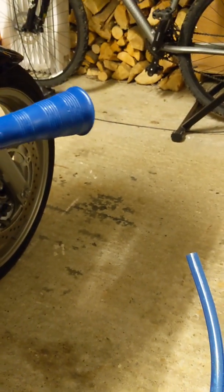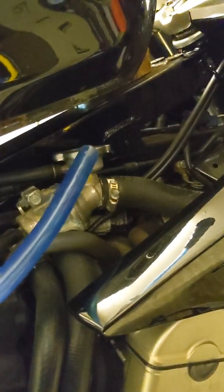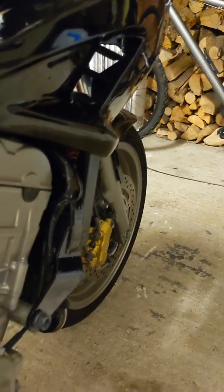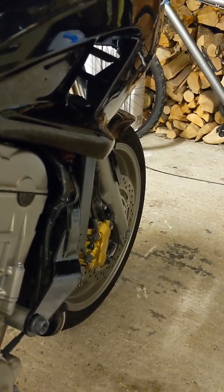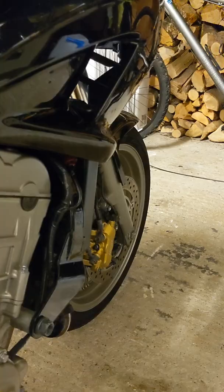Okay, so remember, pre-mixed coolant, which is good. Now this end of the hose here that you're looking at just now goes into there, obviously not at that angle. I tended to do it, let me just, if I can do this, not very well, not one-handed anyway. I tended to have this end right above the screen like that, and the other end, so this end, down straight into the thermostat housing there. Now that worked quite well. I emptied about 2 litres of pre-mixed coolant into that thermostat housing until the level came up to the neck of where that cap should be applied.